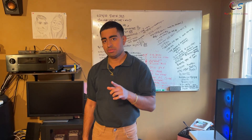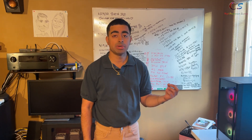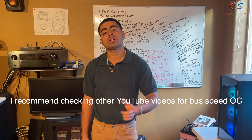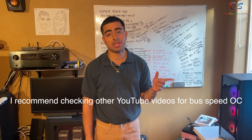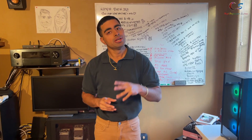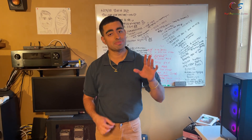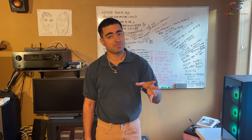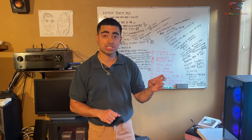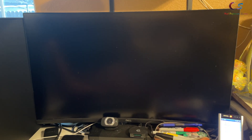Next let's talk about overclocking. There are two ways to overclock X58 platforms, depending on whether you have an unlocked CPU. Without an unlocked CPU, you increase the bus speed in the BIOS. We have an unlocked processor, which makes things a lot easier and more stable. Back in 2010-2012, people laughed at extreme edition CPU buyers spending a thousand dollars, but if you still have that CPU now it's way easier to overclock. We're going to use ThrottleStop, which makes it even easier.